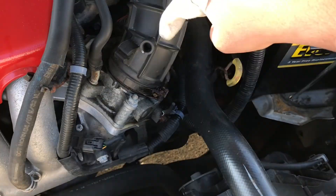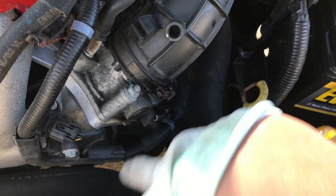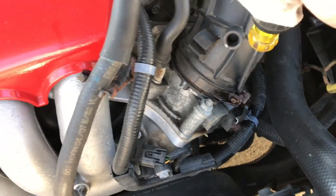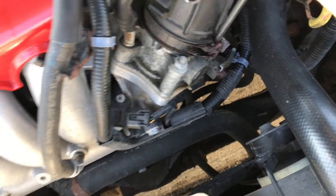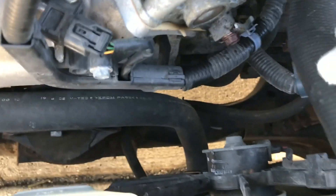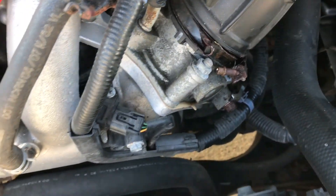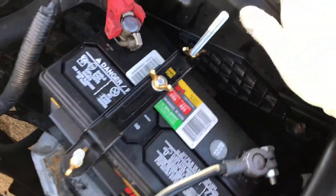Alright, we have to take this bolt off which is connected to the silicone piping or tube for the intake box, but my bolt is completely stripped so I have to break it. I'm just gonna stick something in there and try to break it. There it goes — so rusted, guys. That's the thing about working on older cars. The cover broke right off — look at that, saved me so much time. Just pulling as hard as I can, got this piping off.